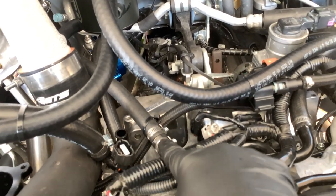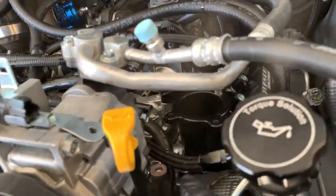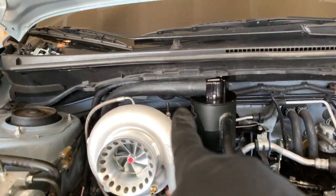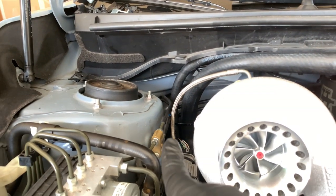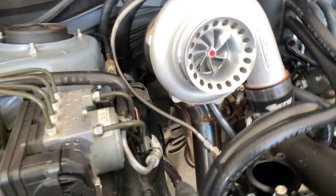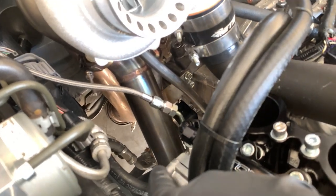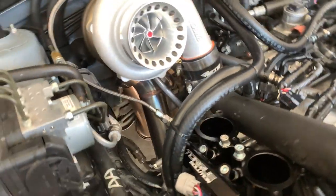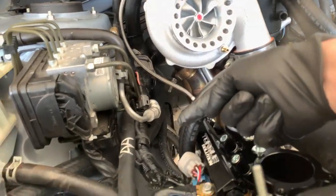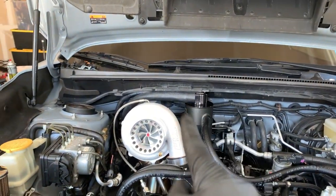You'll see there's a joint right there — that brass fitting we got. That connects and goes over to our water pump housing. If you look closely, there's two hoses here: we have the big vent and we have our coolant line that comes down. It also has a connector that connects to the back of the head where your normal coolant line would. There it is, right by the pipe there. We've got our main vent tube that comes down, tucks through, and runs over to our external catch can.